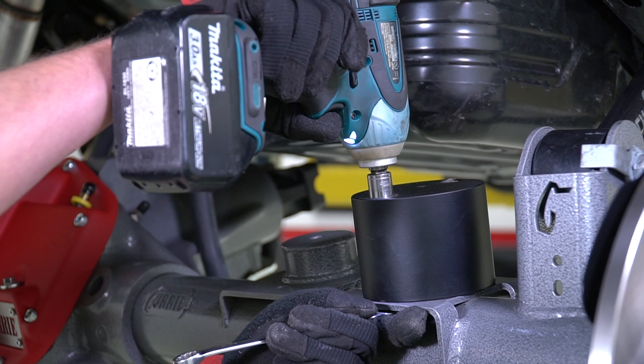Installation of the parking brake cable is done as the manufacturer intended — each cable housing is simply pushed through the mount on the axle until a firm click is heard. Finish the parking brake cable installation by installing the dog bone extensions that will assist hooking the cable into the parking brake eyelet to offset the wider axle track width. The dog bone is held in place with a nut and bolt on the outside while the inside is held by the parking brake cable extension. Adjust the cable as necessary.